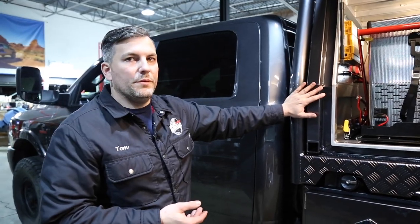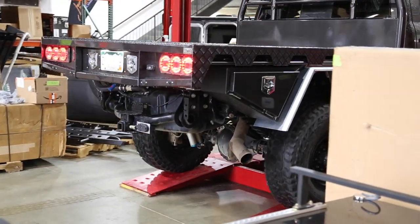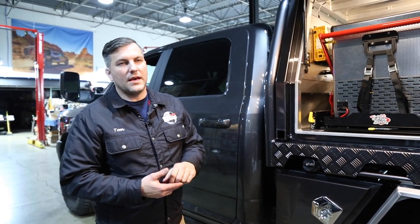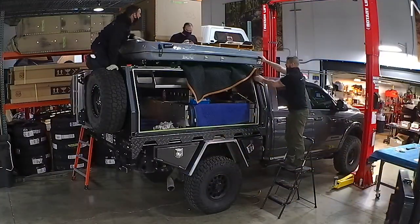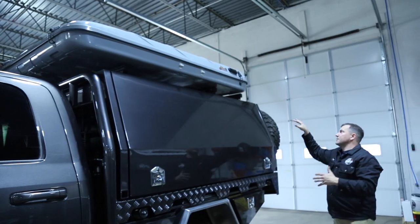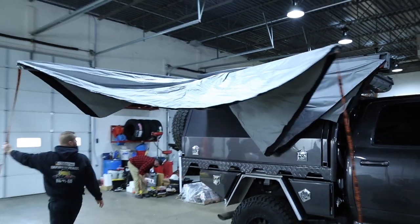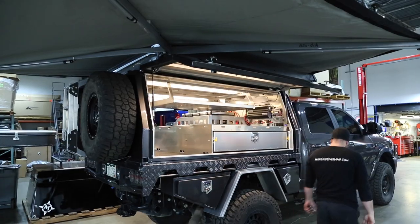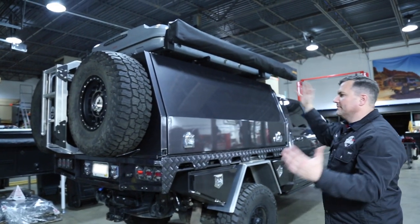This canopy is a wind-off canopy, meaning it's removable. We use four bolts to bolt it down, and you can remove those four bolts and take the canopy off. This tray will also use the headboard, so you can still put those 37-inch spares on the headboard even if you don't have the canopy installed. On the roof up here, you can see we have a James Baroud — this customer previously had this setup and we've adapted his previous mounting system to this Norweld canopy. We have a James Baroud Evasion XXL. We also have an Alucab Shadow awning on the side. We adapted the Norweld doors to fit the height so he can open the shadow awning even with the Norweld doors deployed. This is a six-foot-eleven setup even with the canopy doors at their lowest setting, so he can draw that all the way around the back side of the vehicle to provide shade.